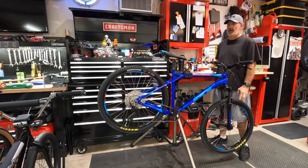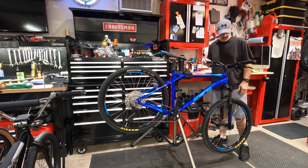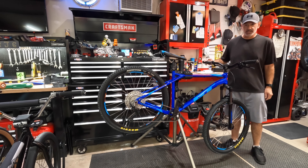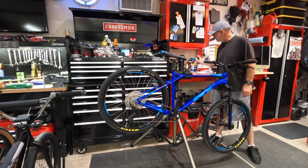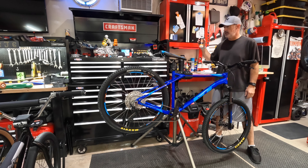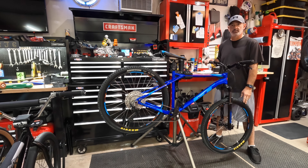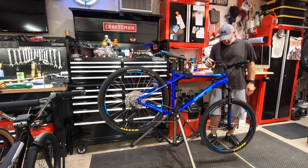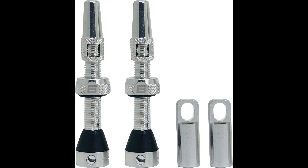I think they were about $30 a piece. It's more of a rear tire, but for $30 it's a front tire for me. I did a tubeless setup. I used TCS rim tape — nice and tight in there — and some orange seal. The first time I put it together it held air. After this last accident, I crashed, the tube kind of bent over, broke the seal, got some dirt in there. I took it off, wiped the dirt out, cleaned it up, put it back together, and pumped it up. I didn't even add more sealant — the sealant was still good, and it's been in there about six months. I used some valves off of eBay, and I'll put all the links for this down in the description. Just some basic eBay valves.